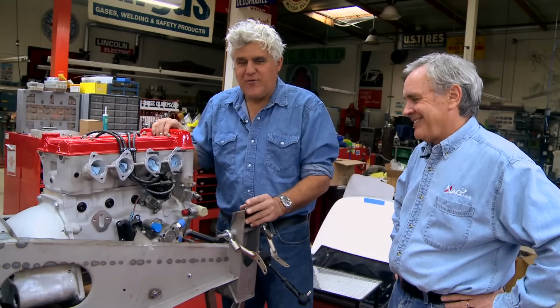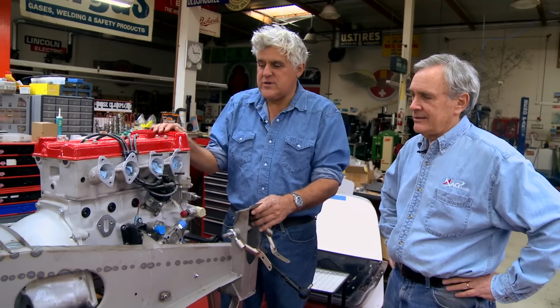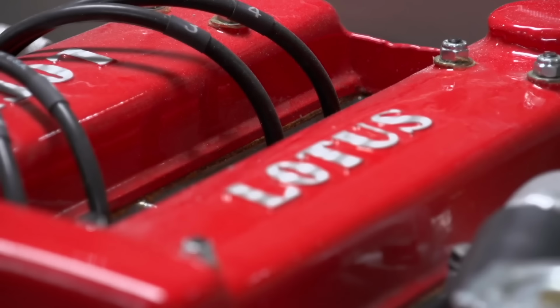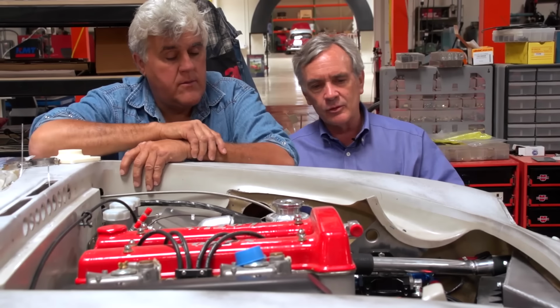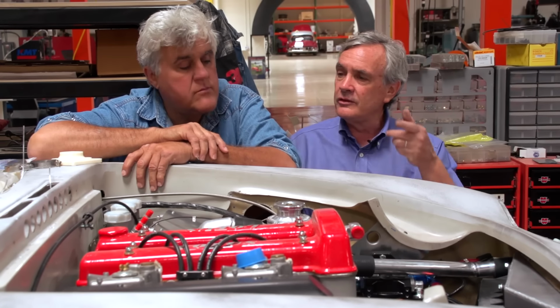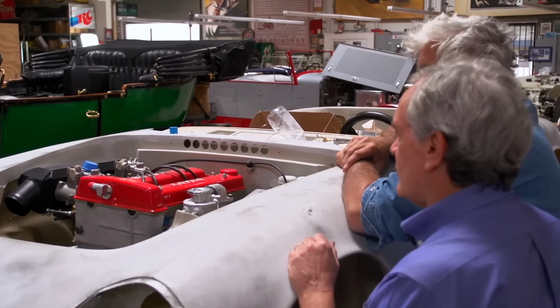This is Mr. Hall's opus, as it's come to be called. People love following this restoration. Well, it's not really restoration. We're building pretty much a brand new car. Now, as you can see, the engine is in. It's got to come out again. I'm doing all the plumbing now. So when we get in close and look at this stuff, I've done all the oil hoses, all the water hoses, built the swirl pot that connects the radiators.